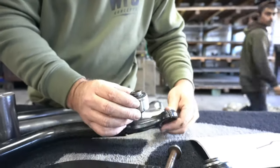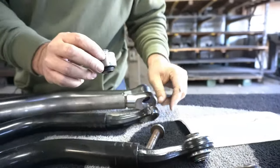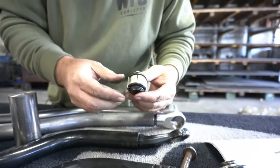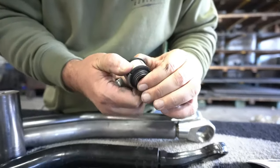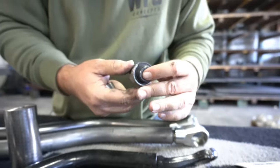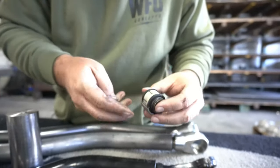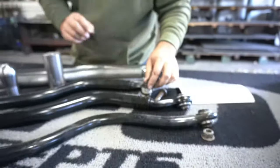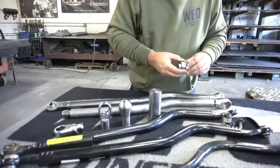As you can see, there's a slice on this. We sliced it and took their uniball apart to see what it was made of — this piece was pressed in here. We sliced it, took it out, removed the outer shell. You can see the uniball move around. It turns out it has a Delrin plastic and a steel uniball on the inside. We wanted to mimic that, only make it stronger.